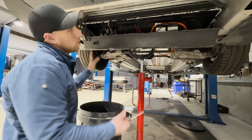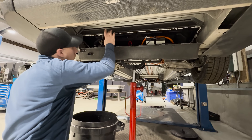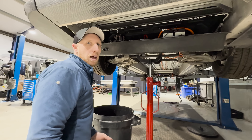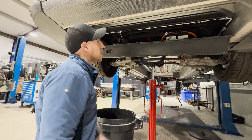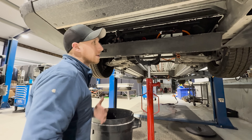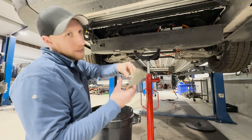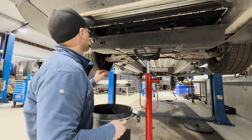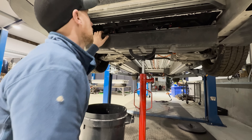We figured this would have been held up with straps and the whole thing would drop out together, but if you look here they actually bolted this piece in first, built this whole assembly, and then glued it into place with tank straps around it that made it look like it was held in like a fuel tank. Why wouldn't you build the whole thing on a bench and then put it all up in afterwards? It is actually sealed really well with butyl sealant, which never goes off properly — it's always a little bit stretchy. This is what Felton use on all their battery packs; it's definitely the right move.